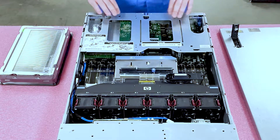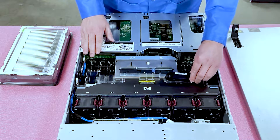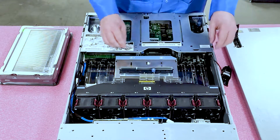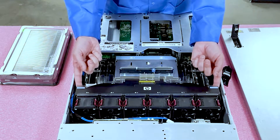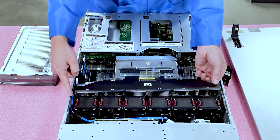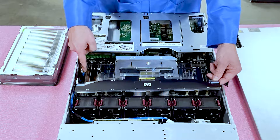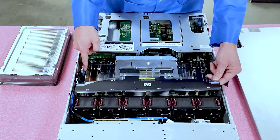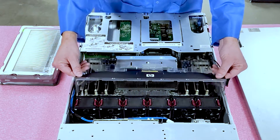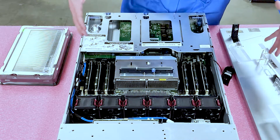With this machine, you don't have to remove anything in the back. The only thing you really need to do is take the RAID out of the way, then the top will just pop right up using the two tabs. I will note on the side they have cables running — it is very snug, and the air baffle is right on the modules. When you put it back on, it can be a little confusing, but that is how it is designed to get the airflow just perfect.